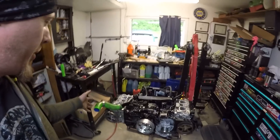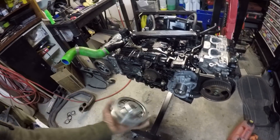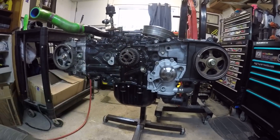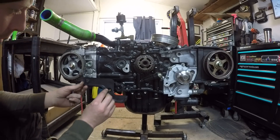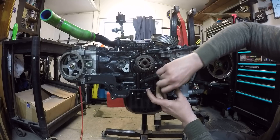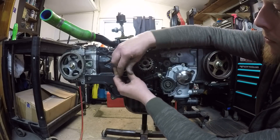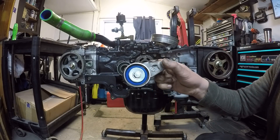I got the other cylinder head on, both valve covers are on, and it took the extra time just to clean up the hardware and it's looking really good. I'm ready to move on to the timing next. I'm going to put on all the idlers and install a new belt. Once everything's lined up I do want to turn this thing over a few times just to make sure everything's going to be good. To start with, I'll put on this little tiny rear timing cover piece — there are just two 10mm bolts that hold it on. Then I'll move right onto the idlers. I'm going to be reusing the GMB idlers — they're really quiet and still in really good shape. I'll leave the last one off until the end, and I'll be reusing the tensioner, which I've already got loaded up and ready to install.